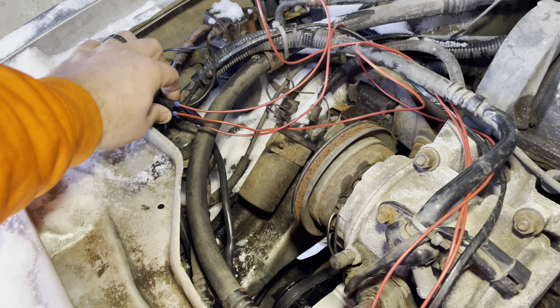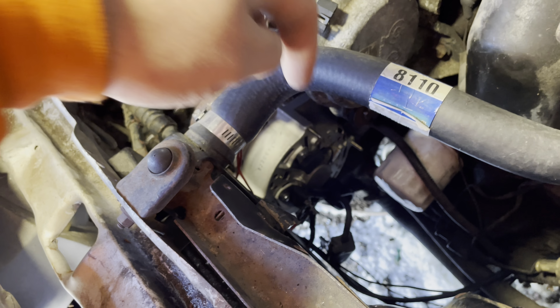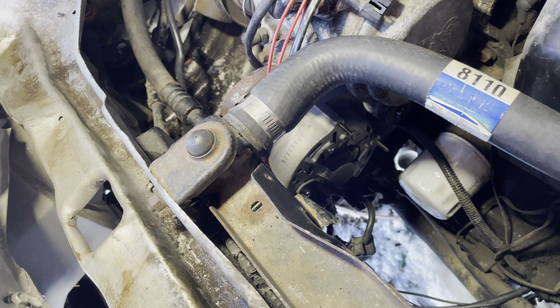Just to get it up off the bump stops, put some used shocks in it or see whatever I got laying around — trying to do this as cheap as possible. Anyway, I got back, was doing a pull, and it started charging at like 18 volts. I was like, hmm, that's probably why none of the lights work — they're all burned out.